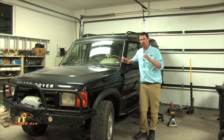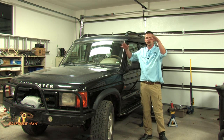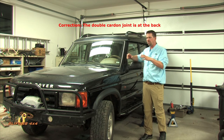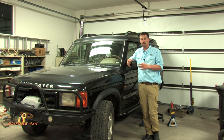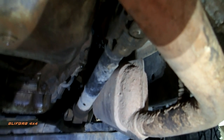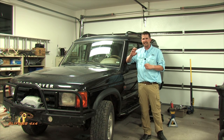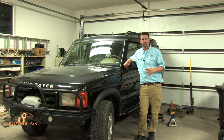The front drive shaft of the Land Rover Discovery 2 is a double cardan shaft, which is nice for alignment with various lift sizes because you have two U-joints and a ball joint in the center, plus a U-joint in the back with the slip yoke. They used high-quality sealed U-joints, but the problem is the location of that front shaft is right next to the two catalytic converters. Temperature kills — the heat dries out the grease and it seizes.